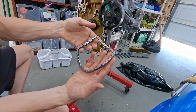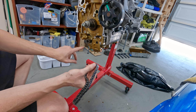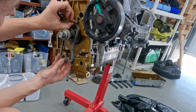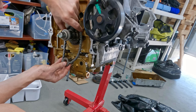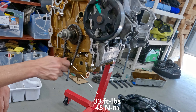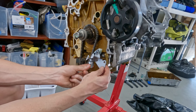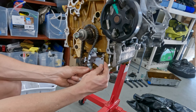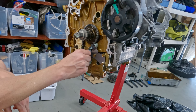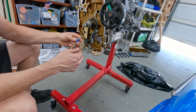Using the balance shaft pump, things have to be in time. The way I took off the factory one: these two links were lined up with the dot on the sprocket, and then this link up here goes to top dead center on the crank. The sprocket sits in a little groove that you'll feel. These bolts are all around 9 foot-pounds. When we're ready, we take this guy out and now we have tension on our chain.